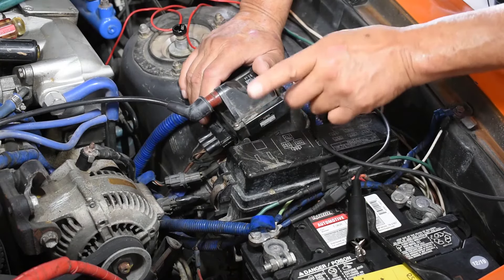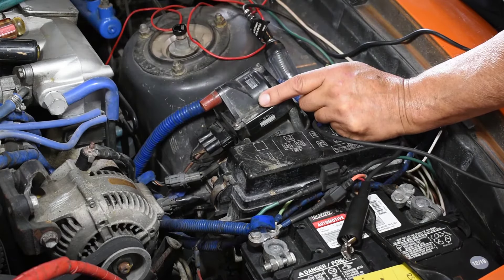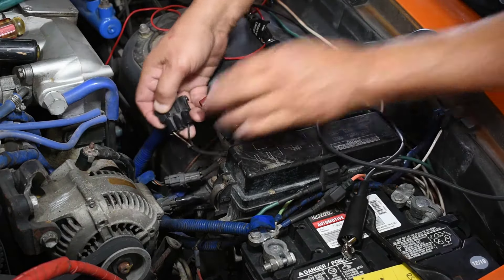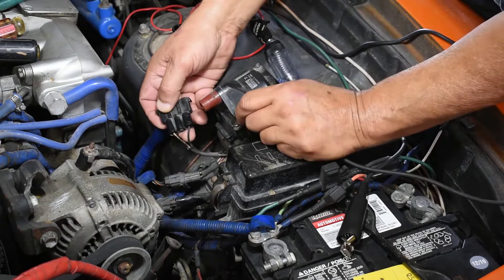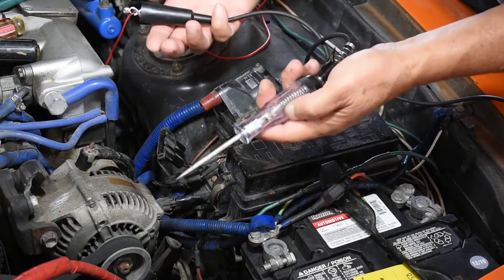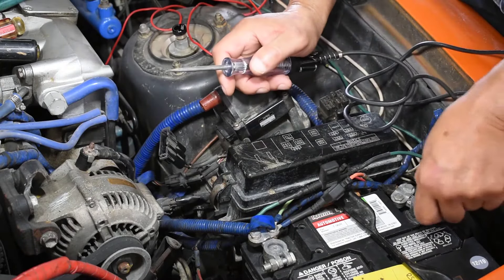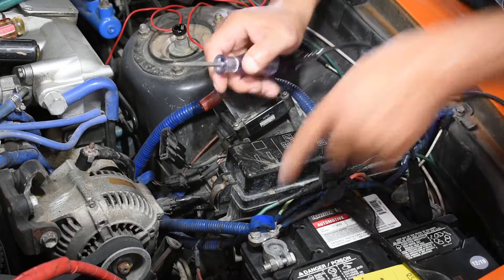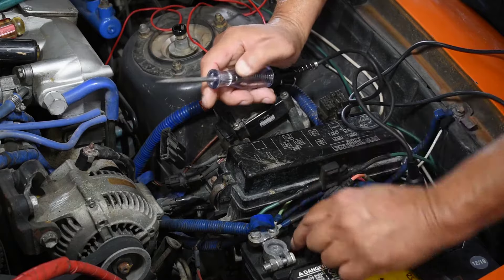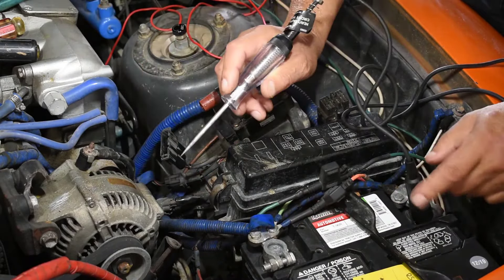Under the hood, there's something important I want to show you. Here's the same coil. I've got the latches ready to go, and it's like most electrical loads — there's two wires, a positive and a negative. I'm going to take my test light and hook it up to the negative. I believe my negative is right here. This is a good example of how it's very hard to see the polarity marking. If I shine my light I can tell — the alligator clip is on negative.